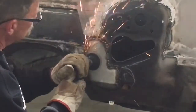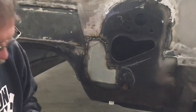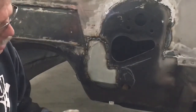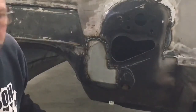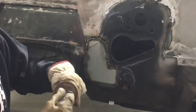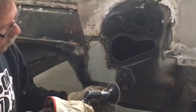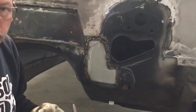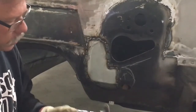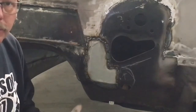As well. So I always start with 3-inch, and then I have different air tools too, but as these rubber pads wear down, I'll go ahead and shave them down, let them get down to about 2-inch, and then I start using the others. And so I try and keep multiple tools around in different sizes, but you throw these things away just because they get worn down part way. You can clean them up real quick and use them on a 2-inch, and I have some all the way down to 1-inch.